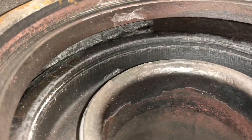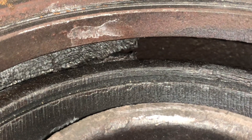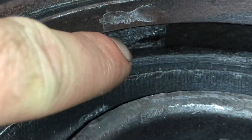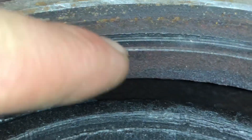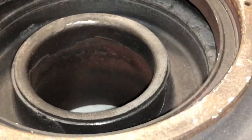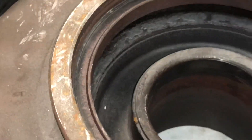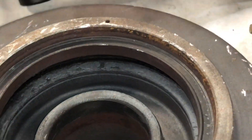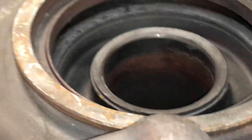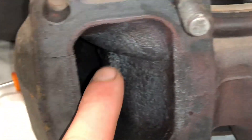Pieces are dropping into the turbine blade, damaging the turbine wheel, causing it to eventually go out of balance and leak oil. You can see it's split really bad at that divider, and it's also cracked right here where the bearing housing meets it. It's probably going to be hard to machine even if I wanted to, because it's likely out of alignment by now and I can't line it up easily.